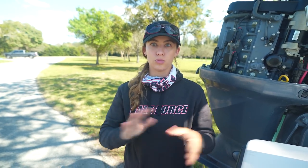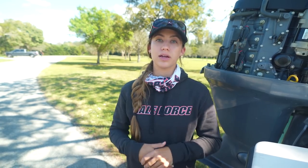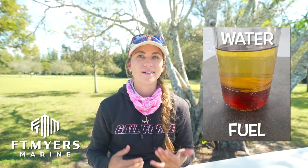That's why your fuel water separator exists and why it's important to replace it every 100 hours. If you're in an area where gas stations frequently give you water in the fuel, you might want to replace it every 25 or 50 hours. Brian sent us a photo showing a fuel water separator he emptied — there's a lot of water in that fuel. We'll probably make a whole video on how to change your fuel water separator.